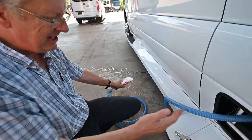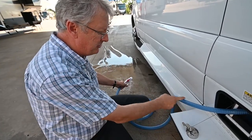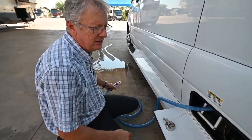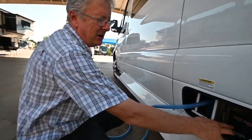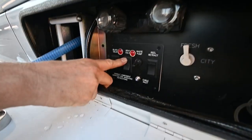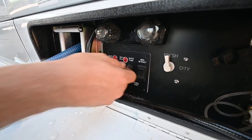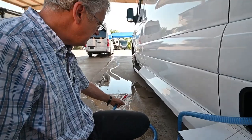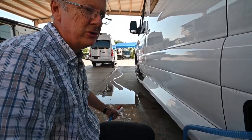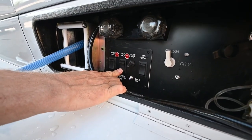I'm going to turn on the macerator here with the waste pump - if I have anything in there it's going to be pumping it out. My tanks are fairly empty right now but it's going to grind it out and pump it through the small hose. When it gets to an empty tank you'll hear the pump going up and down - that means we're pretty much done dumping the black tank. I would close that until the light goes off, then open my gray for about five or six seconds. The gray is flowing to the macerator - any water in the gray tank will also come out and flush out my hose. Black first, then the gray. Always leave the valve shut when you're done.